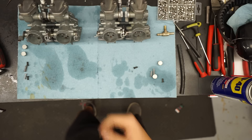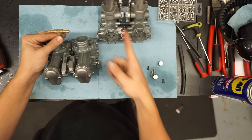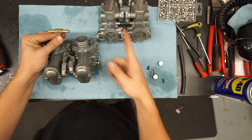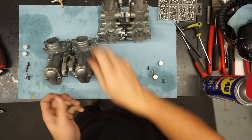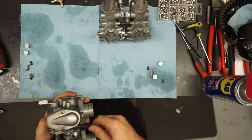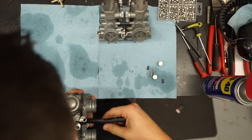For the fuel lines, this will vary based on how your fuel lines were set up. This set had a short line up to a tee and a slightly longer line wrapping around into here. I cut a line about six inches long and slide it onto the fuel tee — it's easier to do it now while you have more access. Make sure it's fully seated so there are no leaks. If you get the proper size line you don't really need a hose clamp, in my opinion.